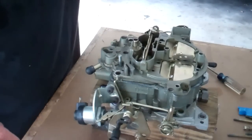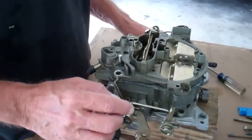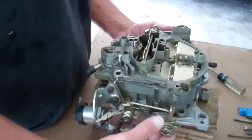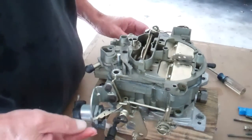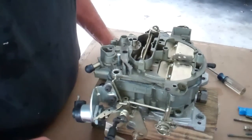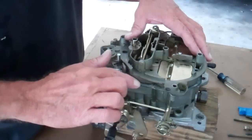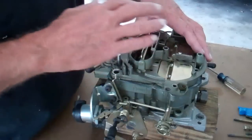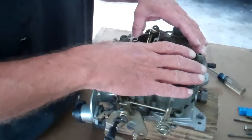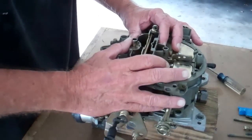This thing is just going to pop free, and the reason is because I've prepared this upper gasket with a little trick I learned from my good friend Neil Stringer. This gasket right here — before you put it on, make sure you've got a good one, and put a coat of white lithium grease on it. It'll sit down in there and you can put this thing back on if you have to come back out. That gasket is still good, still usable — it hasn't torn, it hasn't shredded, it hasn't burned itself to the carburetor. You're good.